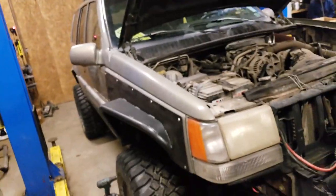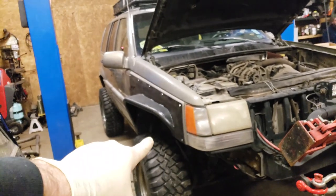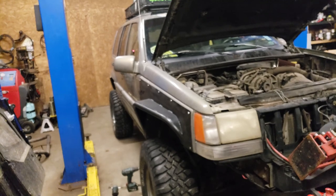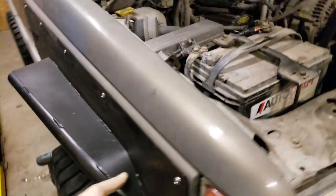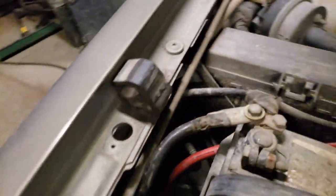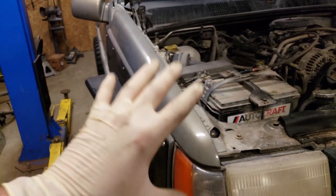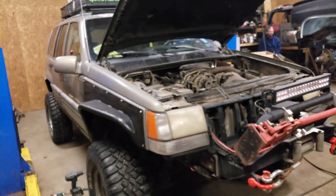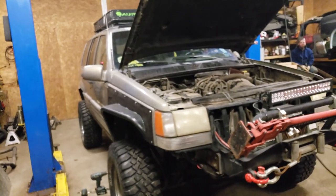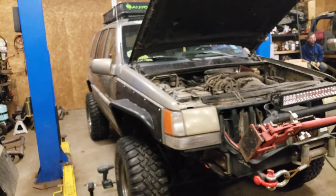You can start to see here what our finished product is going to look like. I'm still going to need that front bracket, and once that's bolted in I'll come to the inside, check where the bolts come through, drill through the bracket, and put my bolts in so that everything is held together nice and solid. And then that'll be it — our Mountain Vista Fabrication flat wide front fender install.